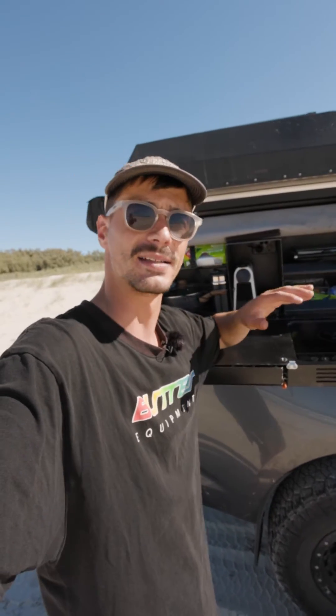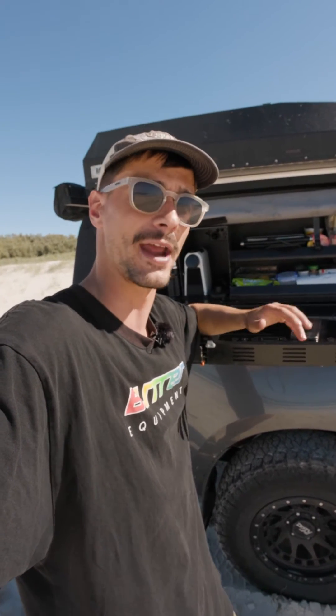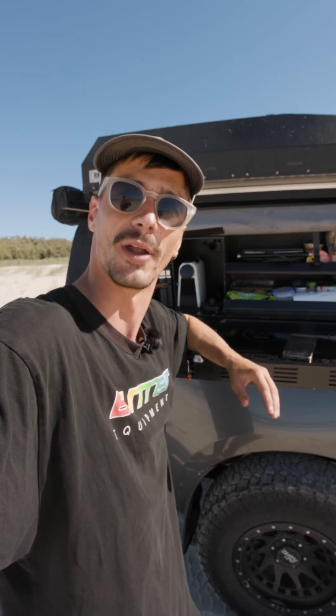As you would have just seen, that was about one hour of driving for 20% of the battery. We're running 200 amp hours of lithium. Most people, when they're designing their 12 volt system, are only thinking about the appliances they want to run and how big a battery they need. But it's just as important to account for your recovery rate and making sure you can top that battery back up nice and quickly.